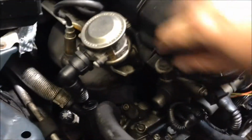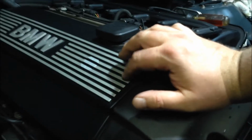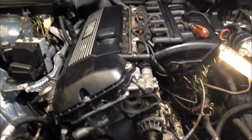On this side, where we were looking last night, I'm believing that it's the actual valve cover here that's leaking again, right around here. I remember when I put this thing together, I heard a crack when I was tightening the spark plug bolt right here. The grommet next to the spark plug. So, hold on one second. Alright, I'm back.